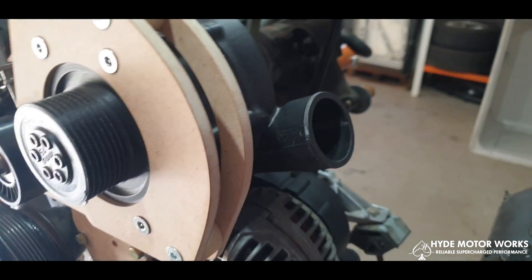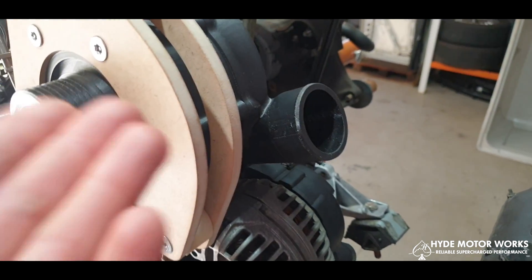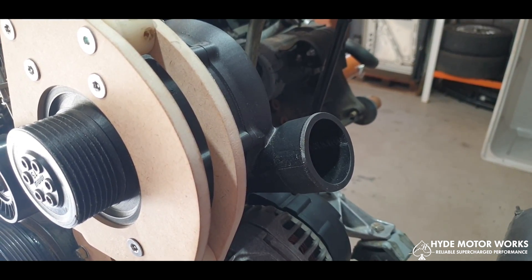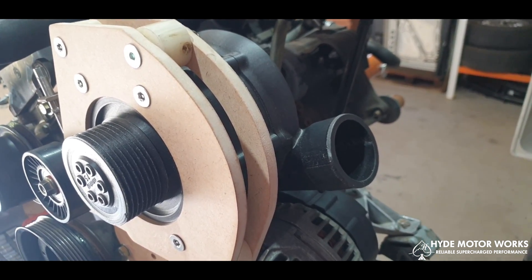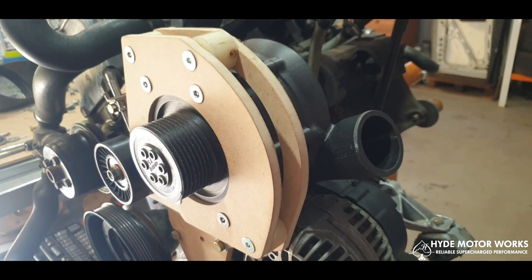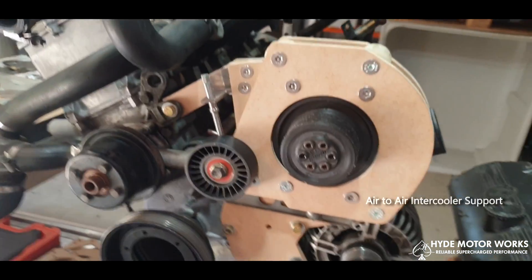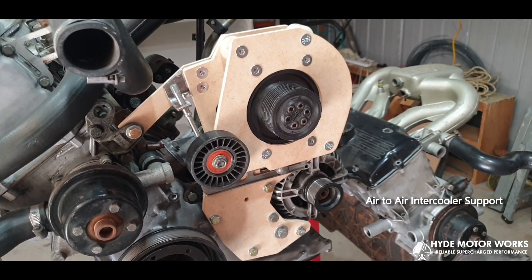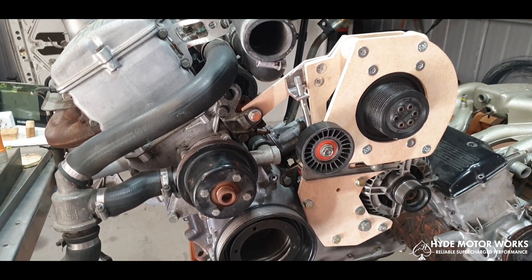The outlet is here — you can actually change the position of this outlet, but I think this one's in a fairly good position. You'd most likely need to run it to an intercooler given the amount of power this can generate. Rotrexes are renowned for not producing massive amounts of heat, but ideally if you're building your engine to sustain such a beast as the Rotrex C38, you would obviously use an intercooler as well.